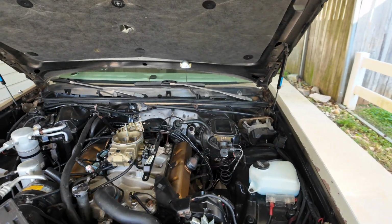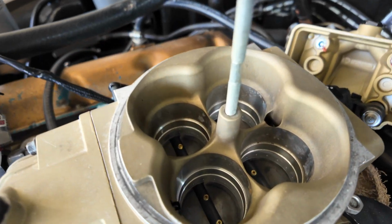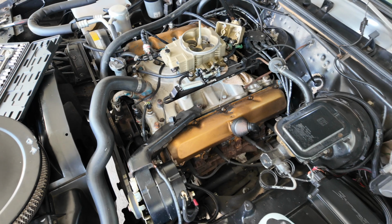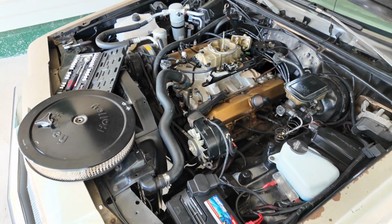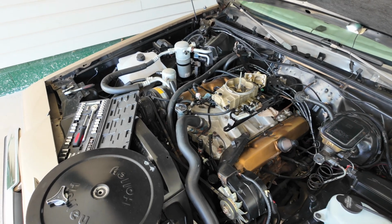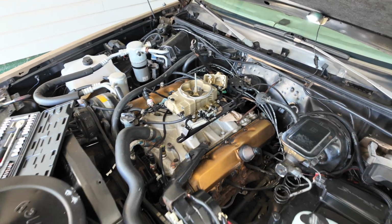But if you ever get the Sniper system or something, I was seeing how it was running lean, and I noticed it when they came out, it was that rear injector right there that wasn't working. So if I would have went in and changed my tune, it would have been incorrect. When I would have got that fixed, it would have screwed everything up. So what I do, I just go in and clear that learn table, so I won't have none of those parameters go to my fuel table when I switch it over. So I go on and get that back on there.